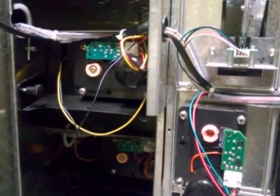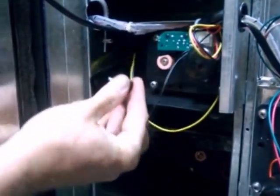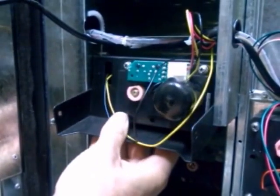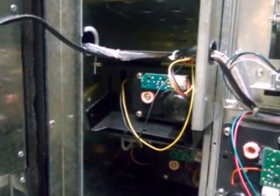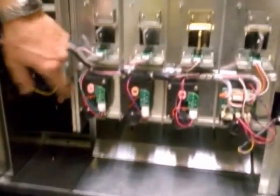And if your motor down here goes out, you're gonna unscrew 2 of these little knobs on each side. When you do that, this will slide out, and you can then unscrew the motor. I'm just gonna set it back there for now. They're pretty easy to replace. But once again, it's a different motor. It only has the notch on one side instead of both sides.